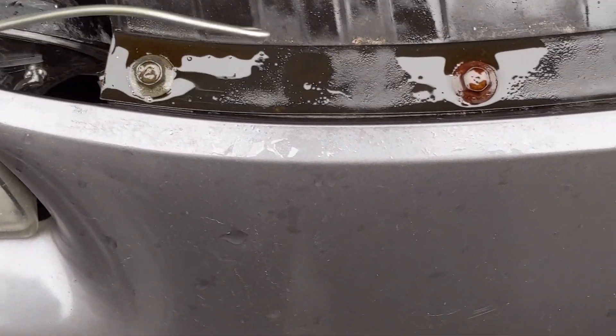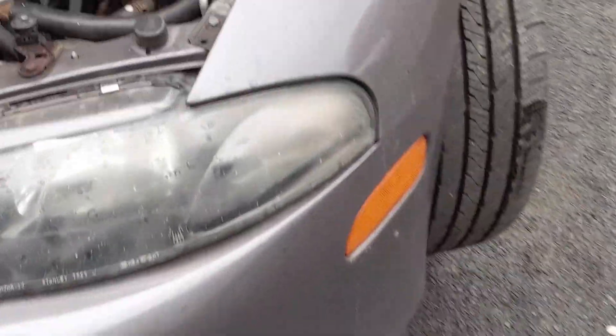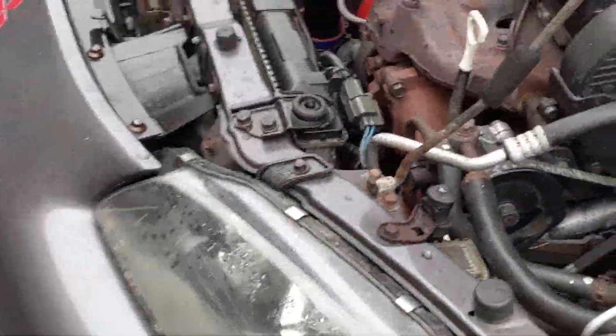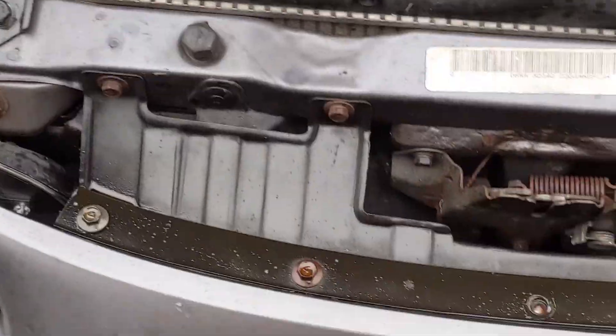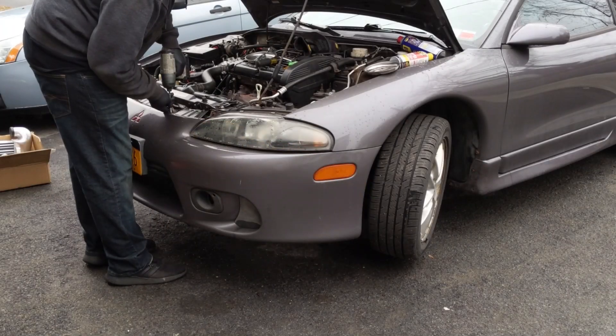She's all up in the air. I got the wheels turned all the way to the left so I could get in and access a couple things from underneath with my low-profile jack. One thing you'll learn if you lower your DSM is you've got to get a low-profile jack or else you can't get the thing up in the air. First thing I did was started to crack a couple of these free, and of course we lost the one in the middle - the other two broke free fine. Next I'm going to start pulling these out with a zip gun impact and pop out all these little plastic clips so I can pull the wheel liner in on both sides.